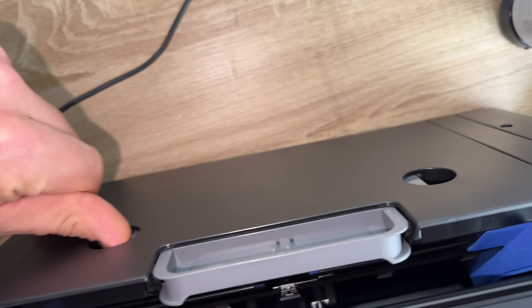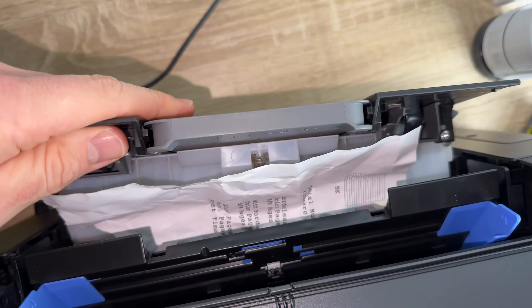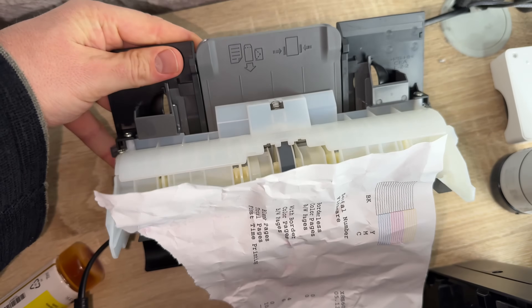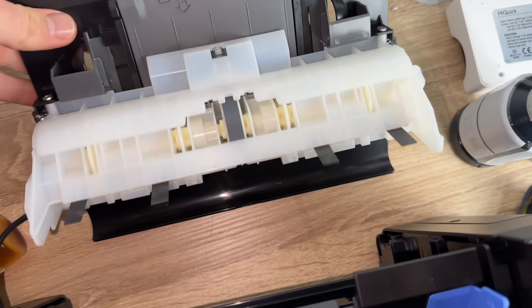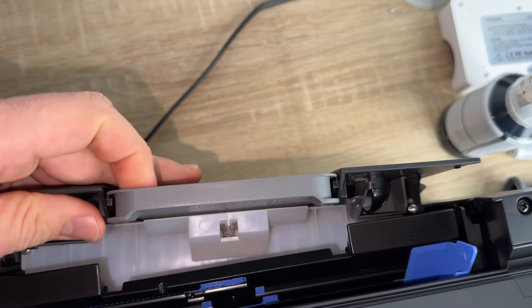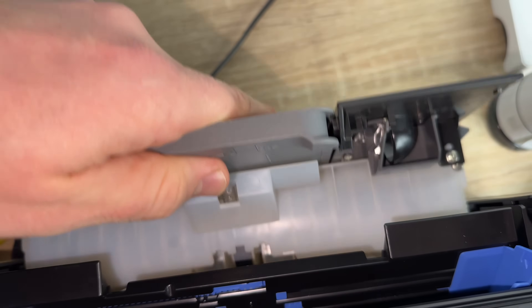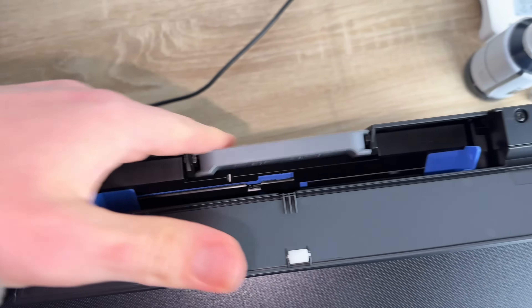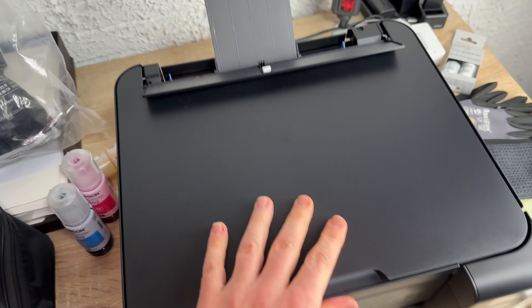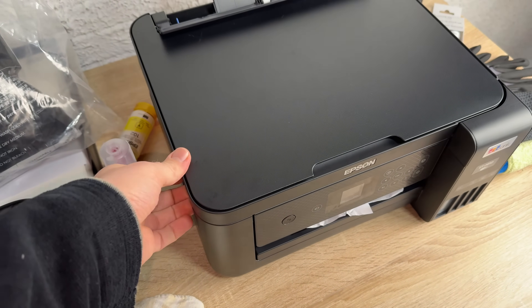You can go to the backside of your printer where you have two locks. If you remove or unlock this area, you will see this is a primary area for jammed paper in this Epson model, because the paper runs through that point and it can happen that the paper will be jammed there. In this case you can remove this maintenance cover and clear the situation.